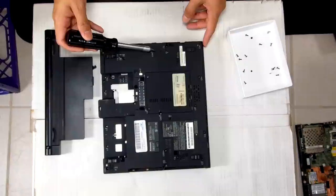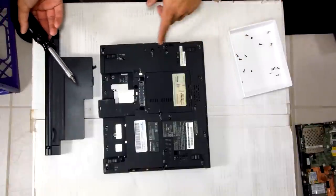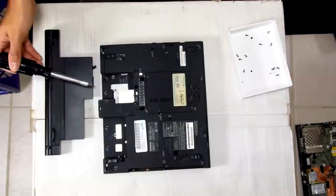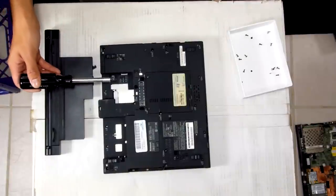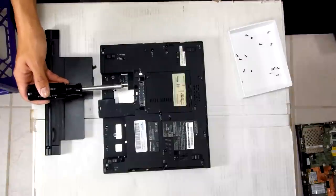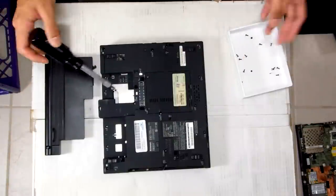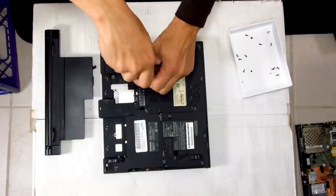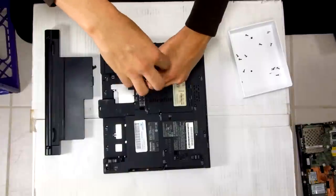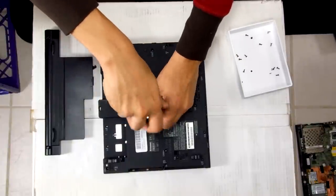What's great — or I should say a downfall — about the X61 tablet is that it has different size screws. Right underneath the battery is the screw guide: A is the smallest, B is the medium, and C is the longest. If you don't follow that, you might puncture the board, or at least you're definitely going to puncture the bezels in front, so it's going to look ugly. I made that mistake with my first laptop, so I don't want you guys to go through that.